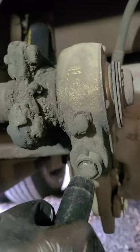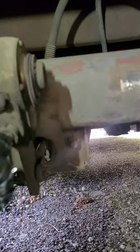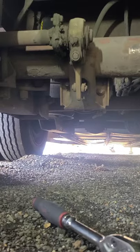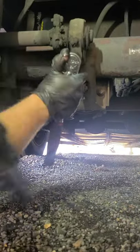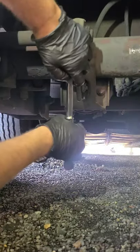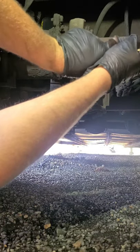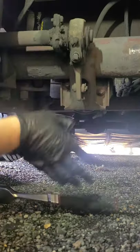On this one, like I said, it's got this sleeve right here that you've got to push back. So it pushes back. From there, you're gonna want your wrench on and you're tightening it all the way down. Make sure it's all the way tight and you back it up a quarter turn, then half of that quarter turn, and you are adjusted.